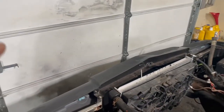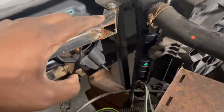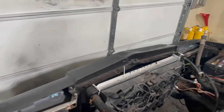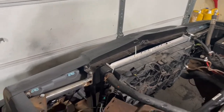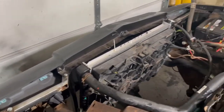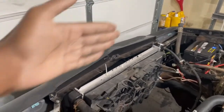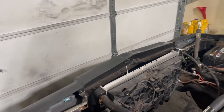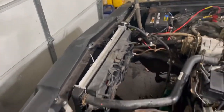Do the same thing on the other side and I can paint this. You can see there are open holes here — I have to cap those on both sides, so I'll weld those up, get everything nicely painted and rust protected, and we're one step closer. With all that done, we can put the hood on, have that support coming over here, fit the latch — all of it's going to come together. The core support was holding me up, so I'm excited to get that on.